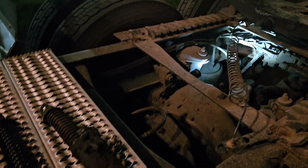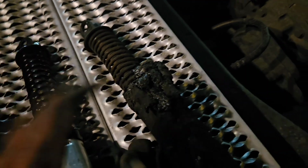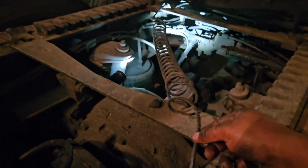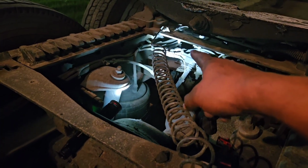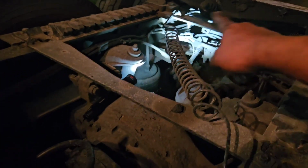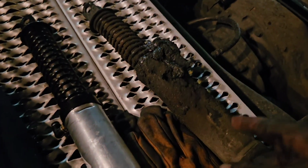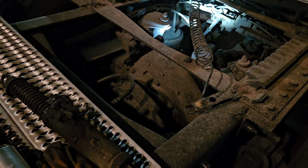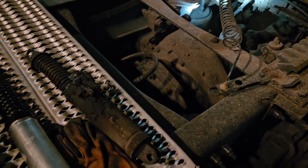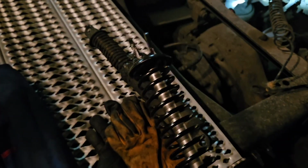So make sure you clean your airline. It's going to have just as much oil and grease as you see on here on the airline, so wipe the airline off. This is 2 parts. This part goes to a coupler right there, and then there's another line that goes maybe, I don't know, 8 inches, and it connects into this cylinder. So seems to be going well. Let me go ahead and put the new one in, get it buttoned up, and test it.